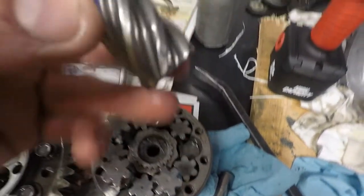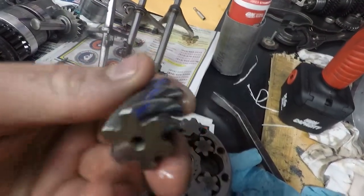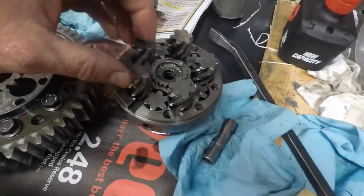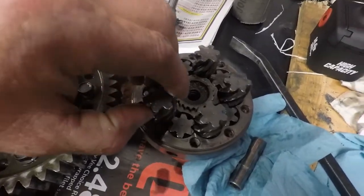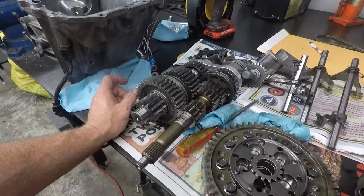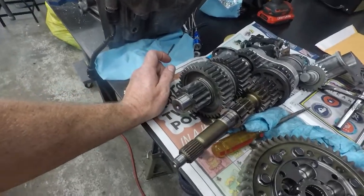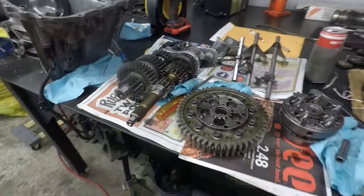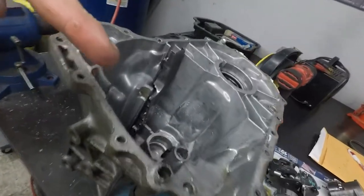At one point I had this apart and had all the helical gears isotropic super-finished, so they're really shiny. It's supposed to strengthen them up — kind of unheard of nowadays, people don't really talk about it anymore. Nonetheless, the diff is pretty much trash. The one-two gear slider is pretty much trash too — supposedly you can't fix them because the lugs are so small on the eight-lug; the six-lug has bigger lugs. Then there's a bunch of bearings on top of that.